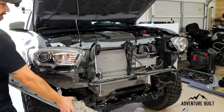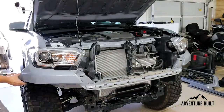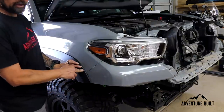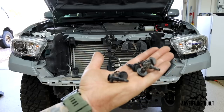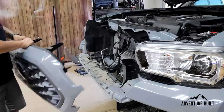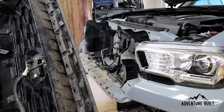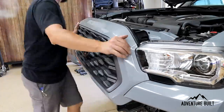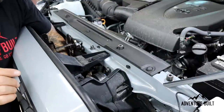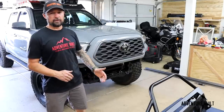Now we're going to put on what's left of the bumper. Installation is going to be the same as the removal, just in reverse. On these edges, just make sure they're lined up and then press in. Don't forget to press in on your fender — there's a clip that you had pulled out. Time to reinstall the push clips. Don't forget, if you're going to reuse your factory driving light harness, to plug that in. Time to install the front grille — index it off the bottom, making sure these tabs go into the front bumper. Work it in from the bottom. Make sure to reinstall the tab and the bolts on each side, and do not forget to reconnect your SmartSense — the sensor behind the emblem. All the hard work of prepping this for the bumper is finally done.